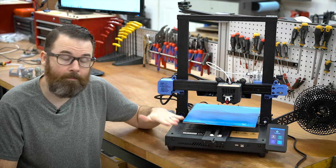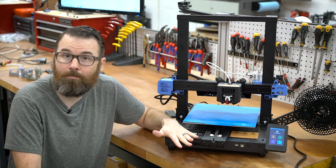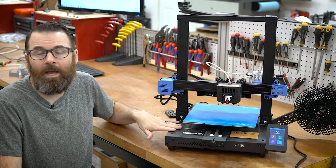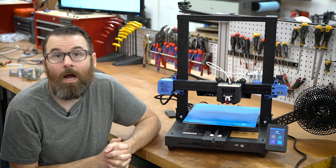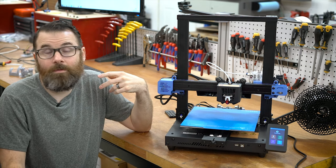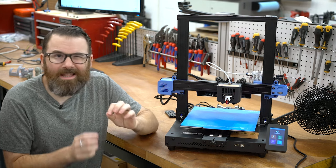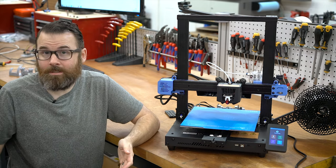The printer does suffer from not-great print profiles — they're using Cura with very generic settings that seem like they just set the print speed to 250 and didn't do much else. It requires extra tuning to get better quality at higher speeds. If you like tweaking and tinkering, this is a great option. Overall it's a robust printer suited for the more knowledgeable user looking for something faster as a secondary printer for prototyping. It would work as a primary printer too, but needs more tuning to match something like the Ender 3S1 at a similar price.